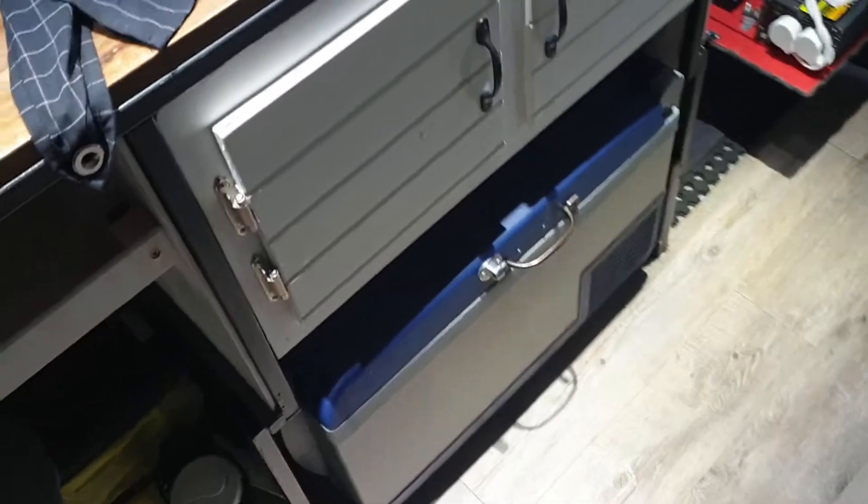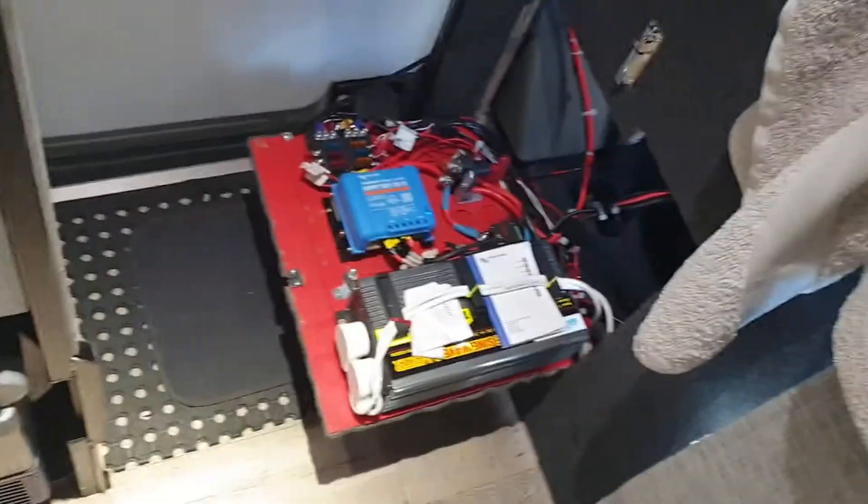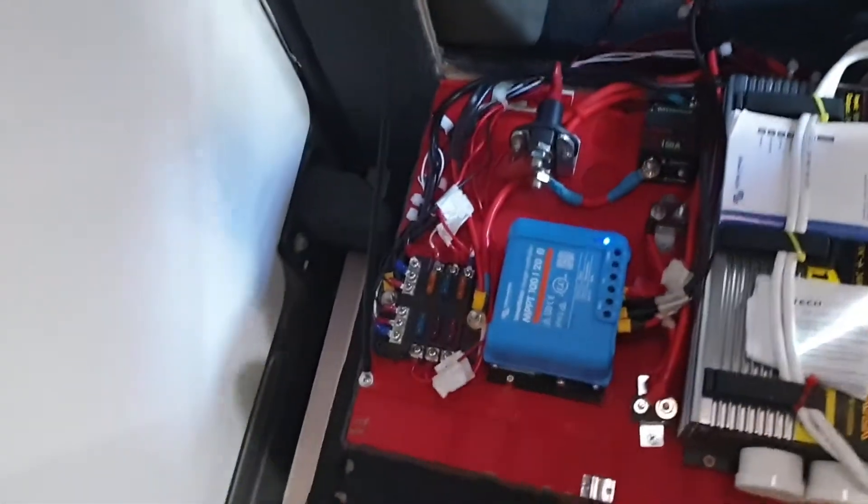When I installed this, because it's a 15 amp appliance I ran a 15 amp cable to it. That's where my fridge lives and that's where my electrics live — pretty close together, but I can't run a cable directly because this is a walkway. So I ran a 15 amp cable from my fuse box, down under the ground, behind the back of the shower, behind that corner, up the wall, across through the conduit you can see just here, and the outlet came out just here.